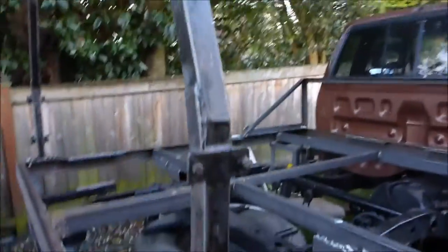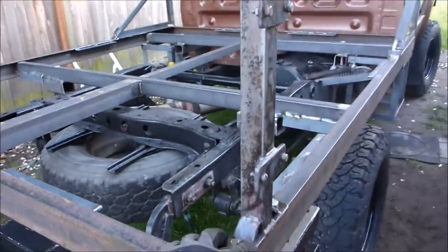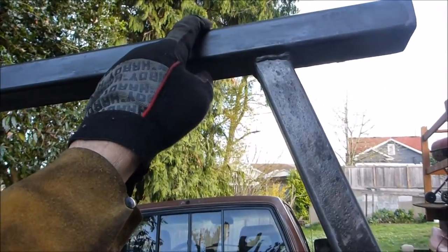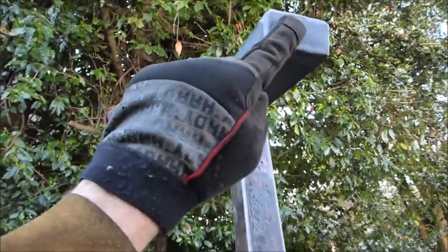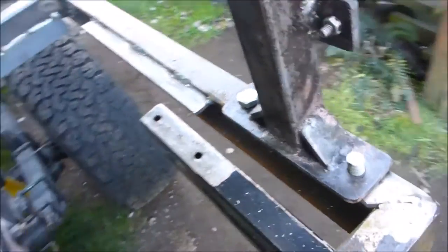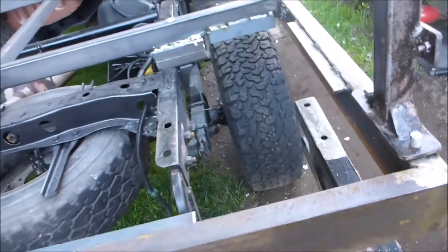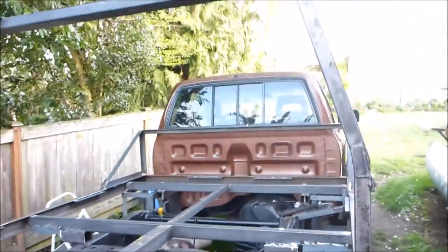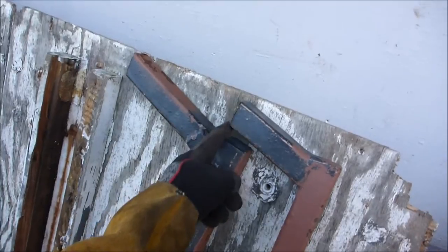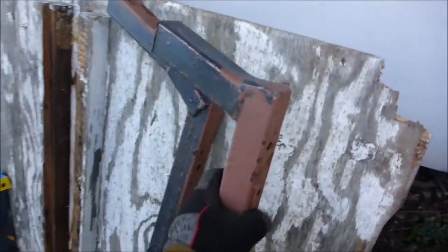Here it is with the rear bar fitted. These pieces here are from the old truck — these bars are new capped-off rectangular tube. I fitted it in there loosely; I'm going to have to weld some nuts in there so I can attach it on and off as needed, if I wanted a pure flatbed without a rack in the way. Lesson learned on the over-bars: here are the original ones, which I cut off to put the rectangular tube in.